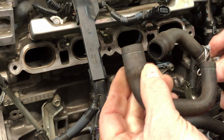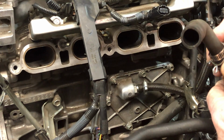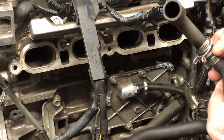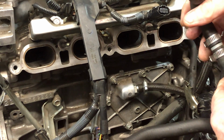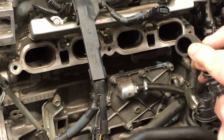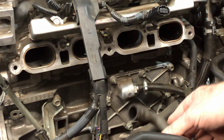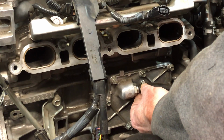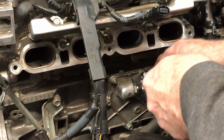On the intake manifold, it's much larger. So I just cut that, did half of that, and spliced the two hoses together. I think it was a 3/8 piece from hose to hose, and that made it perfect. And then this goes on the intake just like the OEM one did. It was perfect. So couldn't have been any smoother. So then just get that lined up.